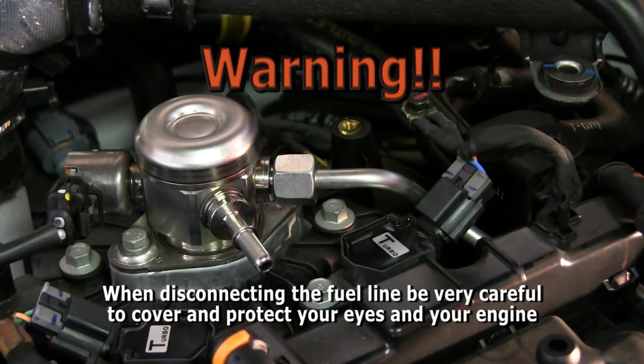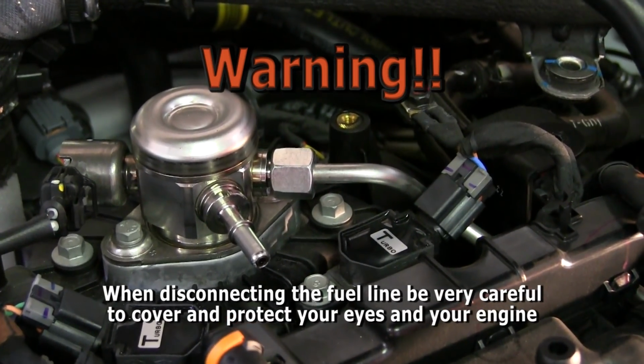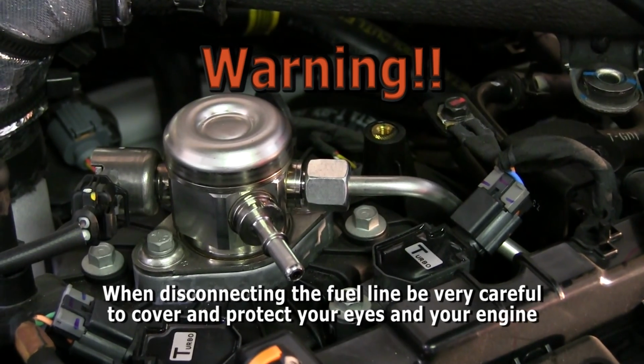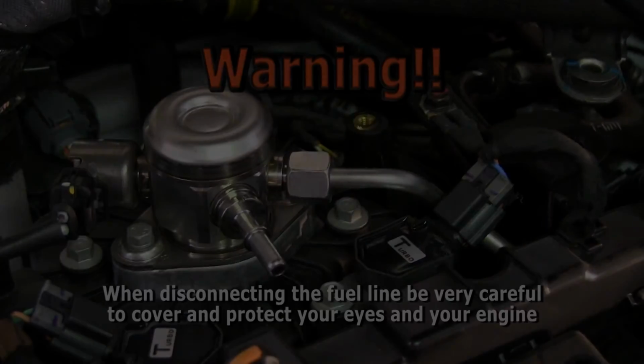This is actually a fuel pump for the direct fuel injection on this engine that creates an enormous amount of fuel pressure, and there is no direct pressure relief valve, so you need to be very cautious on relieving the fuel pressure from this engine.